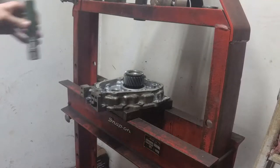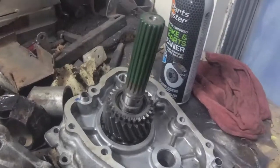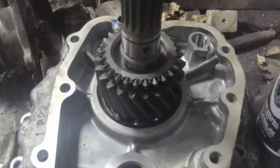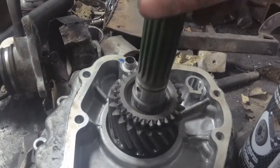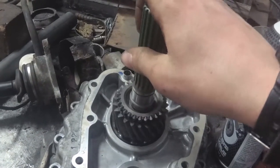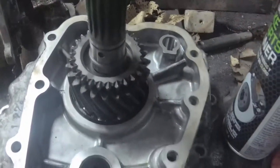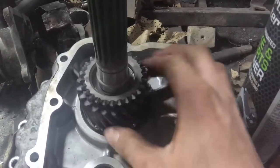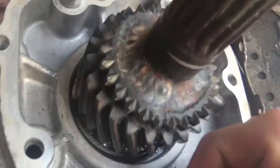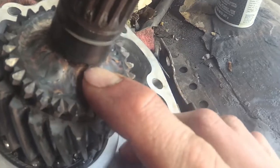So as you saw, that just fell in by hand, so it's not going to be a true interference fit. This is able to turn in here and move right now — this is still cold and the gear is still hot. When I first put it in there there was play, but there's really no slop in it anymore; you can't feel any play in this anymore, so it's still slowly shrinking. It'll probably shrink to the point where I can't turn this, but I'm just going to do a fillet in here with the TIG welder tomorrow. We'll TIG it up and hopefully it holds. We have made progress — I forgot to film it, but I TIG welded our shaft into here, so that should be pretty solid. A little bit of undercut, but it'll work. This runs true, drive shaft can hook up — now we have our two-wheel converted to four-wheel transmission, without buying any parts. If you got a TIG welder, easy to do.